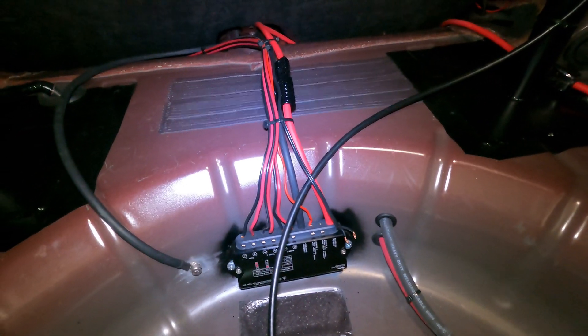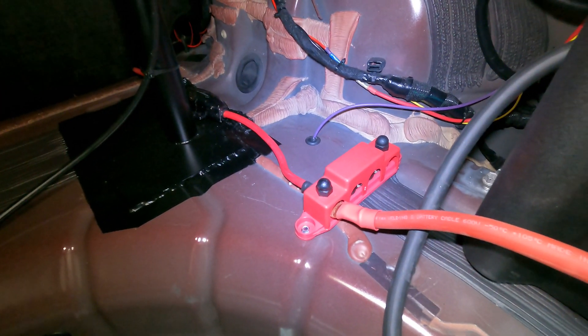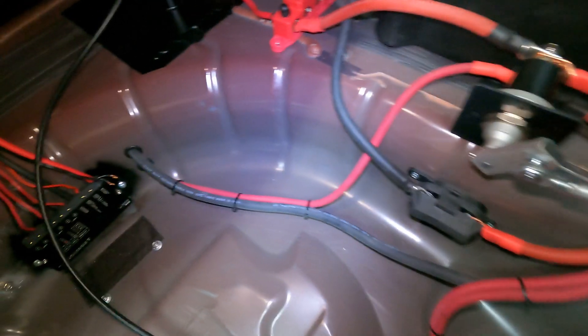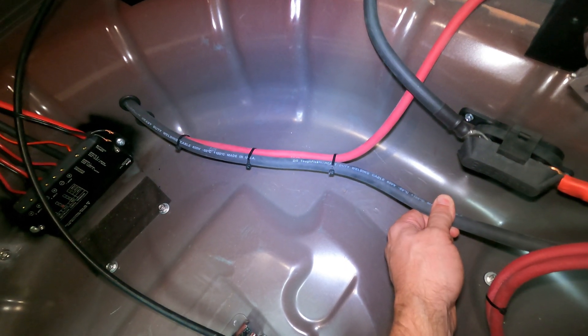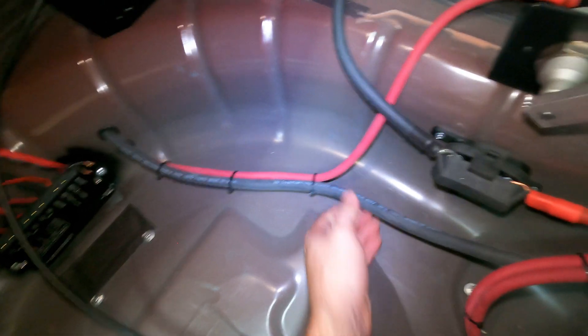This is firing the power line for the fuel system, but if there's any other power I would need back here, I do have a junction box. Just a note on all electrical wiring I use — I do use welding wire. Double-aught for load carrying to the front of the car, and just two-gauge coming back from the alternator.